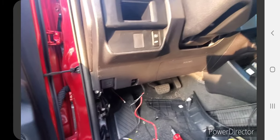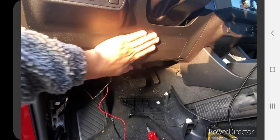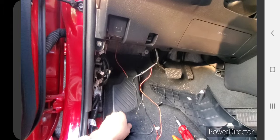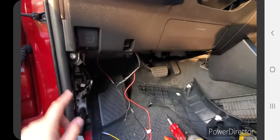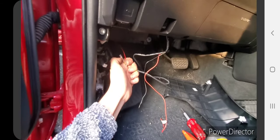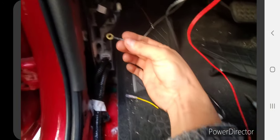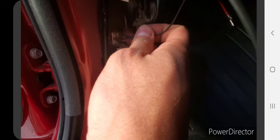Now that everything is bolted back together, make sure the SRS airbag plate is nice and flush with your trim and dashboard cover, and that your button moves freely and doesn't get stuck. Make sure you've replaced all three screws and bolts. Moving back to the cabling — the yellow cable connects to the red cable drawn through the firewall, and the black cable needs to go to ground anywhere on the metal chassis of the vehicle.